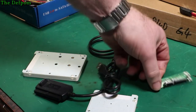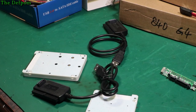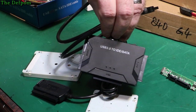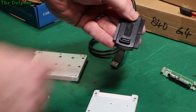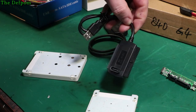The SATA side seems to work but it doesn't work with this adapter. I'll just try different options and they're all fairly cheap things. This definitely works - I've had a SATA hard drive, like a spinning disk hard drive, connected to this and they work fine. These do have SATA on them as well, but you have to use the external power supply to power it because that's just purely the data connection.